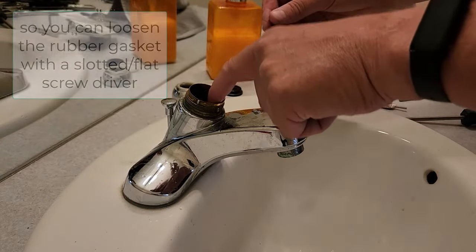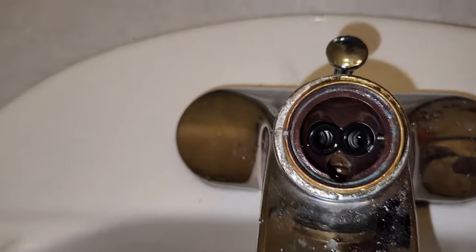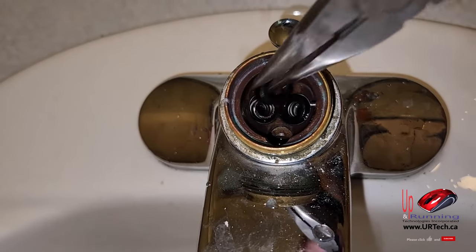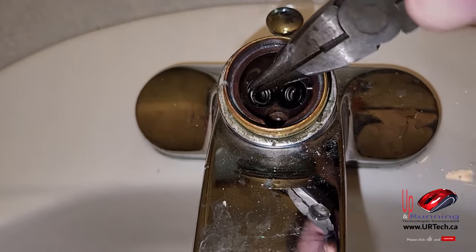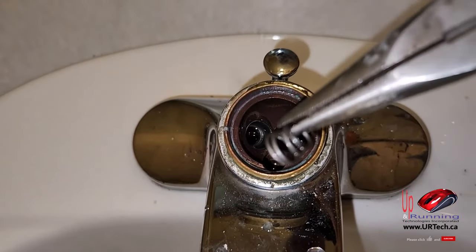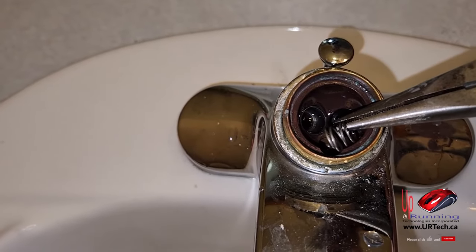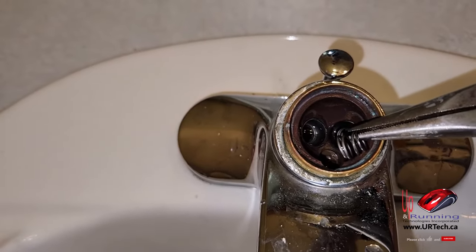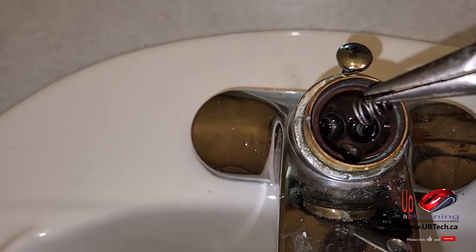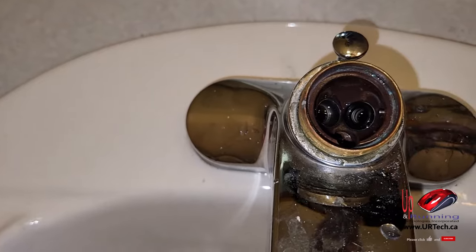Let's take a look at what's inside because that's really what we have to repair. A rubber seal actually sprung out and popped across the room when I was changing the camera lens, so I just put it back so you could see it. There's that little rubber grommet and there's also this spring. One thing you can do if you just want to patch this up is elongate that spring — that'll probably help — and then put it back together. However, I've spent the $13 and I'm going to replace it. The spring is conical — narrow at the top, fatter end at the bottom — so remember that when putting the new one in.